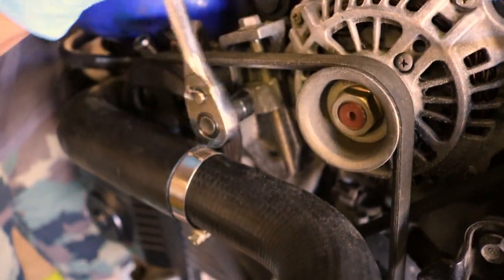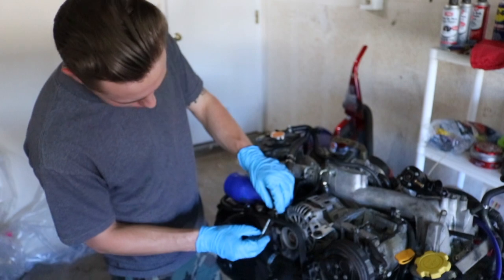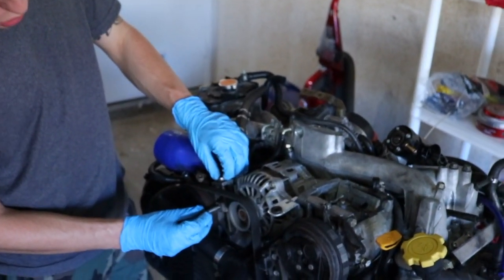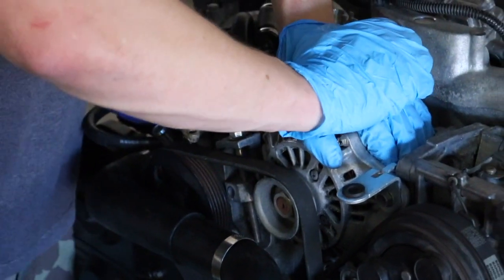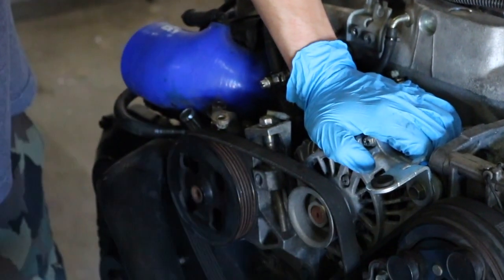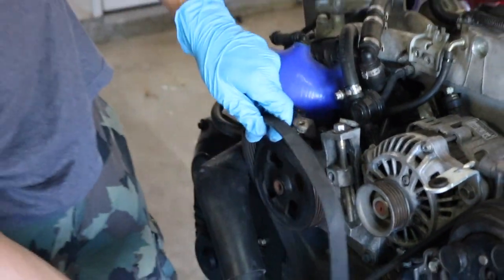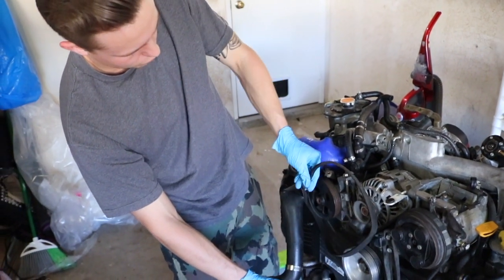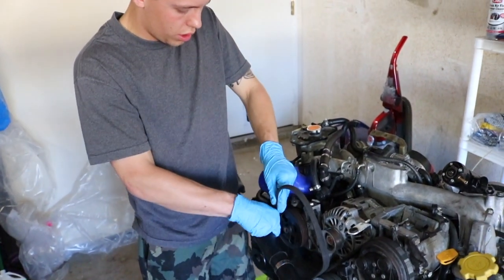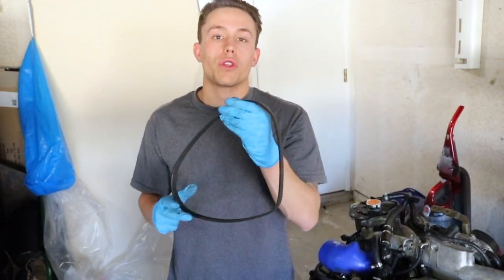This process will be exactly the same for anybody who's doing this in the car — our motor just happens to be out of the car. Alright, so we just got this bolt out, took it right out of here. Once you take this bolt out, you can actually just press down on the alternator, and as you see it moves its way down, and that will release tension on this belt. Then you can just slide it right off. Once you get your belt free and clear of everything — it's kind of stuck on this radiator hose — then you can go set it over with the rest of your parts.